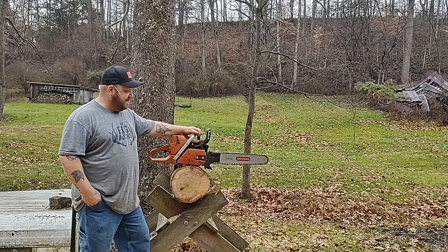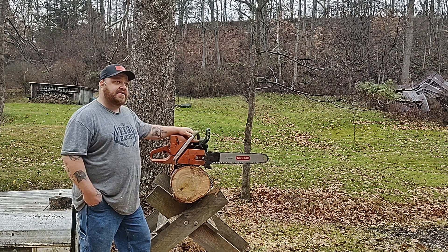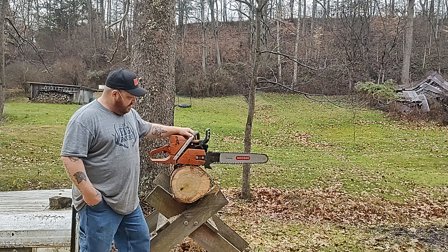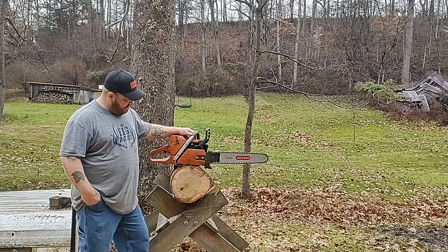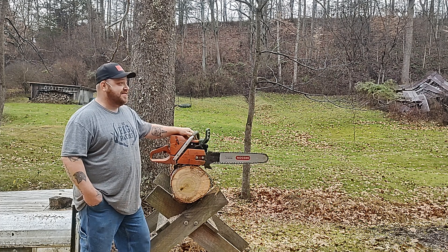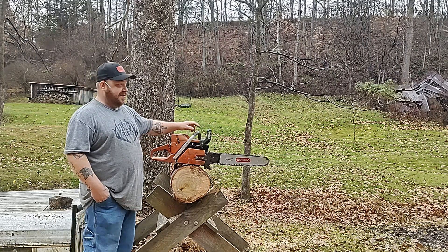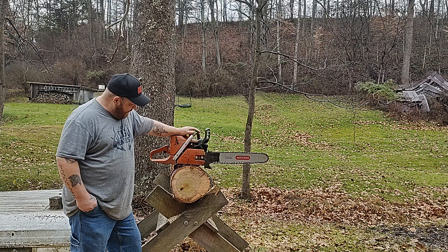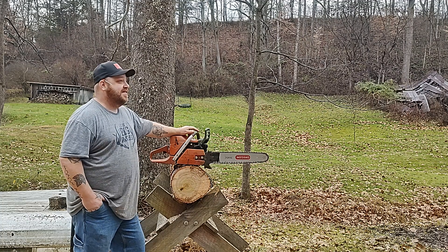This is a strong, strong 50 millimeter saw. It's still got the original cylinder on it, piston ring — I put a new Caber ring in it. It's got a single ring piston. But wow, this thing runs good. This thing runs like a big bore — a good running big bore, not just any big bore. Fingers crossed, I think it's a done deal now.